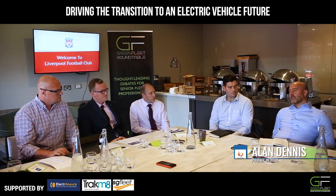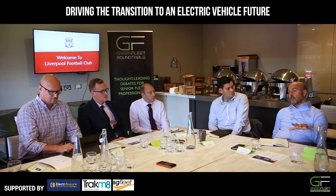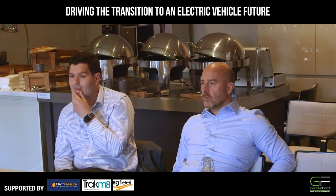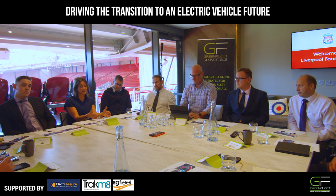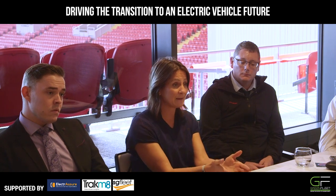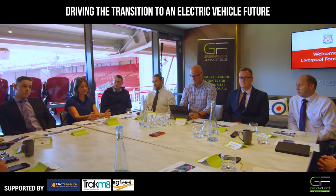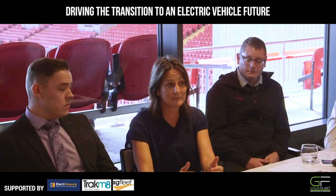It's interesting how we can help with the electrification side of it — whether it's the driving style or the use of the vehicle, that's how telemetry helps match what a vehicle could use on the electric side. We use the telematics data to look at the utilisation of the fleet. Are there vehicles that are being underutilised? We're looking at the predictability of certain journeys — if a journey is done consistently and is within range, that's potentially suitable for electrification. You can partition them out: some are a no-brainer to electrify, some require more thought, and some are in the too-difficult category.